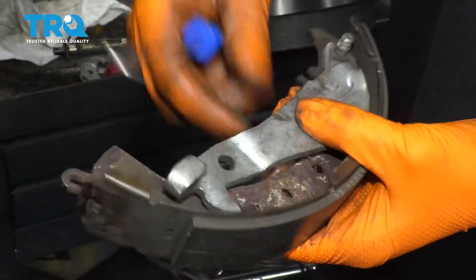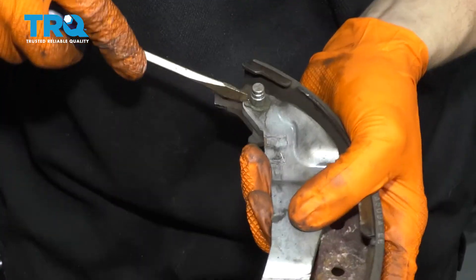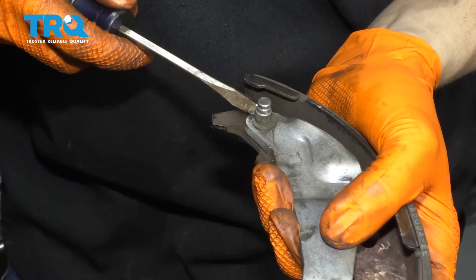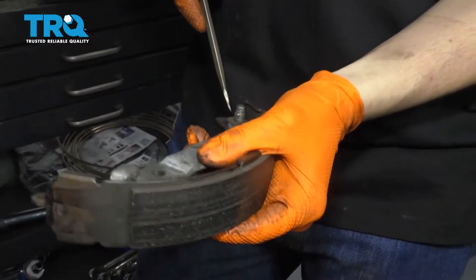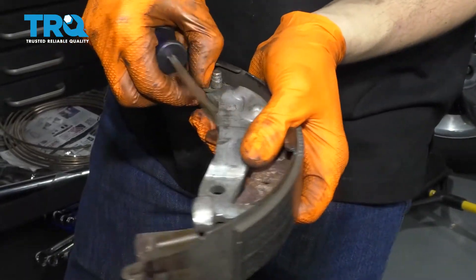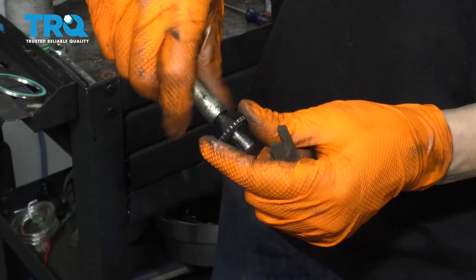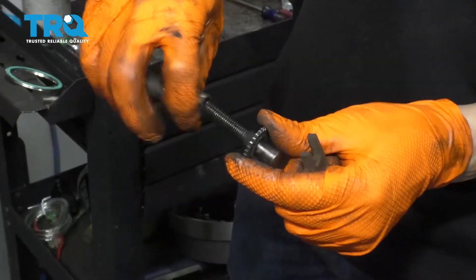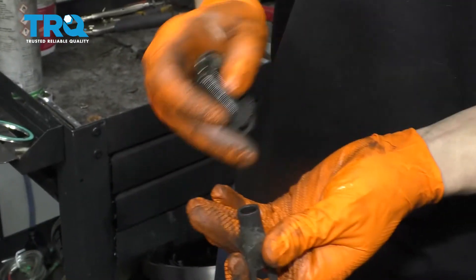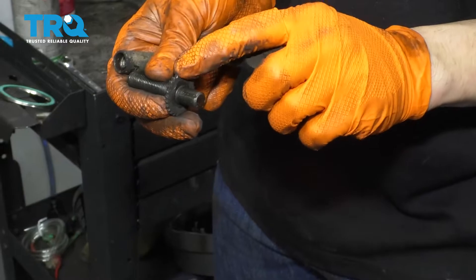Now you can remove this arm. There's another locking ring down here. To remove this with a screwdriver, I'm going to pry in there and basically spread the two ears apart. When you put these on you're supposed to squeeze them shut so it doesn't come off, and to remove them you do the opposite. As you can see, it's slowly coming out. Stick the screwdriver in that hole and pry it out the rest of the way — that will allow you to remove the parking brake lever. This is your adjuster; you want to take it apart and clean it, get all the old grease off and the brake dust out. If yours is seized, use some heat and locking pliers, being very gentle. Make sure you save this little washer — it has to go in between the fork and the adjuster wheel on the side with no threads.